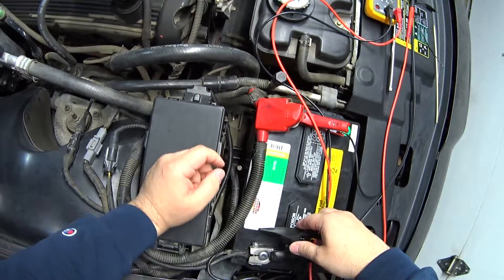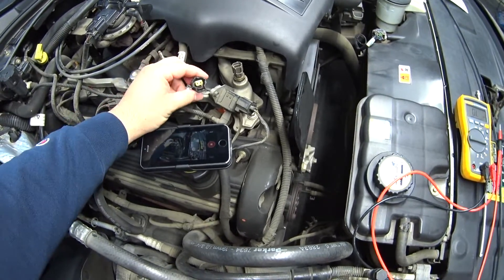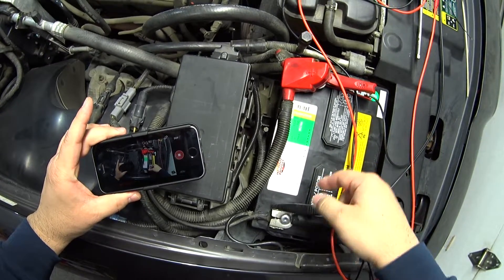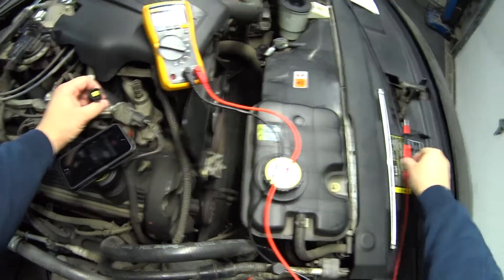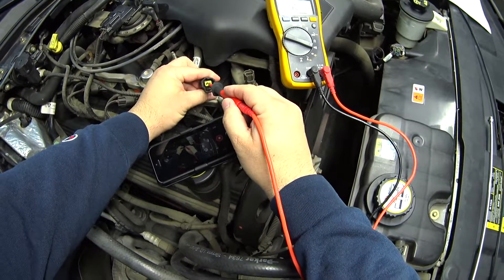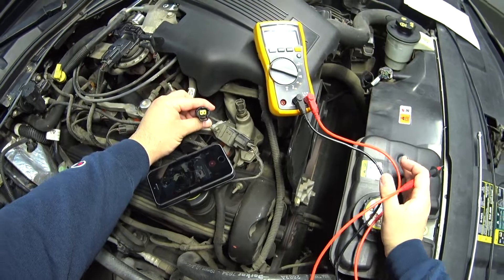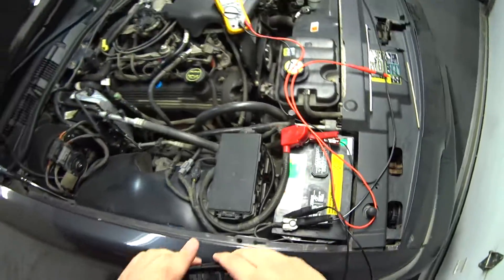Once you get done with that, you're also going to want to check the sensor on the PCM side of things. That means we're going to check to see if your ground is shorted or the power is shorted. Take your meter, connect it to the negative of the battery, set it on continuity, and probe these pins. On this one I'm getting a reading but no continuity, and on this one I'm getting a reading and continuity, so I've got a good ground on one of those. On the other one, I would probably need to set it on voltage to make sure I've got good reference voltage.